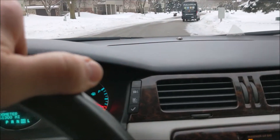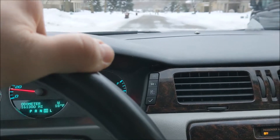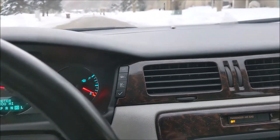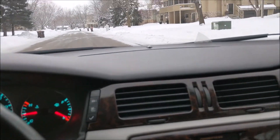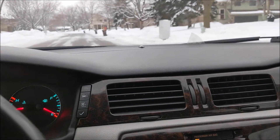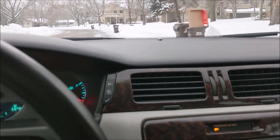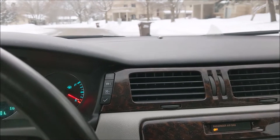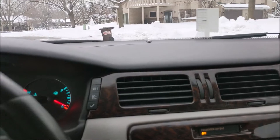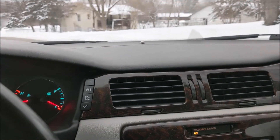Now I've gone close to 300 miles since I've broken these brakes in. First impression - my brakes were wasted so you can't compare fresh brakes to old ones. I had a tough time bedding them in because it was like five degrees outside and I don't think I got them hot enough. I could tell when that coating on the rotors and pads was still there that they just weren't biting. But now they seem to bite pretty well - there's no shaking or shimmying, it seems solid.